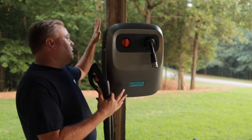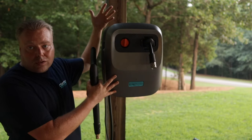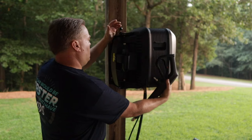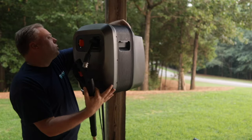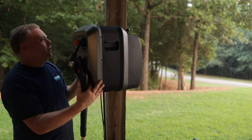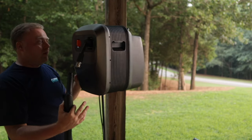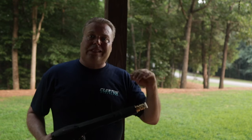It's stout against the wood. It does move a bit because it sits on a swivel notch, so it won't stay perfectly in place — goes about 150 to 160 degrees, and it does go all the way to the side but it wants to come back. Using the 40-degree tip that comes with the unit — 1.9 orifice — we're getting 1600 up to 1700 PSI. The 40-degree should be the least cleaning ability of all the nozzles; the 15 and 25 degree are going to clean better.